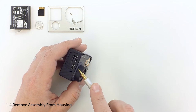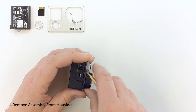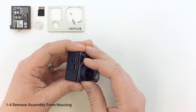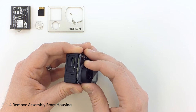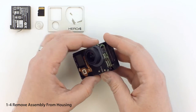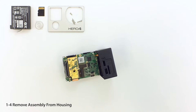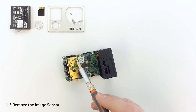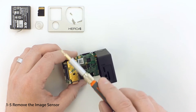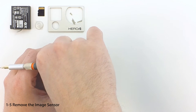To remove the interior parts, gently insert a screwdriver under the housing next to the HDMI port and lift the housing slightly over the ports. Grip the lens and work the PCB board assembly out of the housing by gently rocking the lens assembly back and forth until the internal aluminum plate and PCB board assembly is free. Swing the assembly down gently. There are internal connectors located along the edge of the board — take care not to put stress on them. Remove the four screws holding the image sensor onto the rear of the assembly and set them aside.